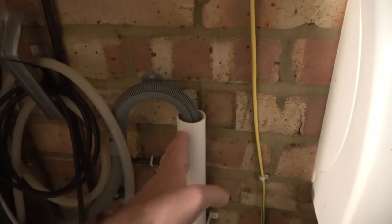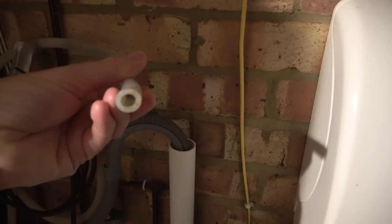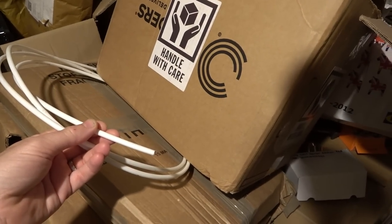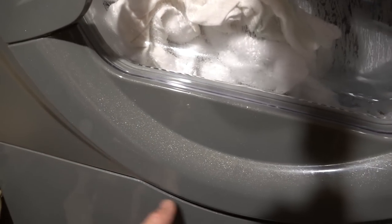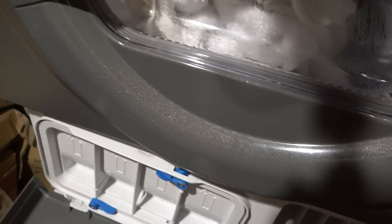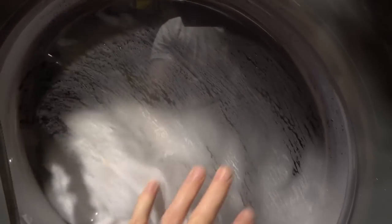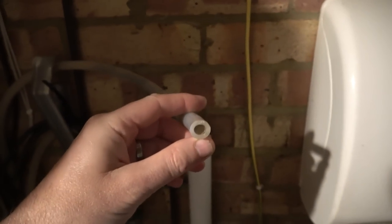What I've done with this one years ago is I actually plumbed it into the main drain that the washing machine goes into. But now when I've got this running, there's no water coming out at all and I have to physically siphon out the water from the bottom part here when you take out this thing that you normally undo and clean out every now and then. I'm wondering whether it's some kind of pump failure. The thing that pumps the water out may have stopped working. There's definitely heat building up here - it's warm to touch and you can see all the condensation and water on this bit here, but yet there's nothing dripping out, which is not right.